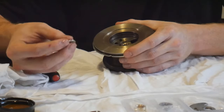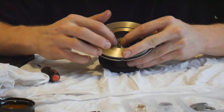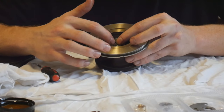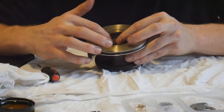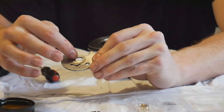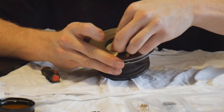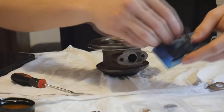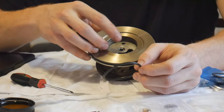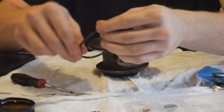Now we're going to pull out the upgraded thrust bearing cap, get it pretty well oiled up too, and just go ahead and drop it right on top of the bearing. Since this is an upgraded thrust bearing cap, sometimes you're going to have to machine the inside of the cartridge so it can fit the outer length of the new upgraded bearing. But I have over a millimeter of clearance here with the upgrade, so I don't think I'm going to have to get this machined. We're going to continue with the rebuild — we'll get our new thrust bearing, put some oil in all of the little dig-outs that it has, put it face down, lining it up. We've got that in there. Now we break out our new seals: the large one for the cold side to the side, and then the smaller one that's going to go right inside here right after the thrust bearing. Oil it up, make sure it creates a really good seal, and then start feeding it in.